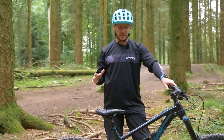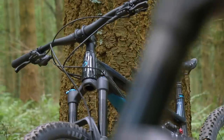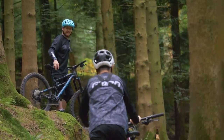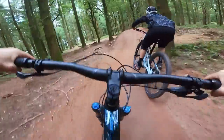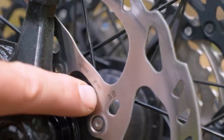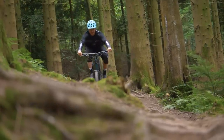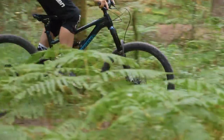The N9 is a mid-range bike and there's not much you'd really want to change on it — it's a super capable bike with 170mm travel front and rear, and even on the 29-inch version that's 160mm, so it's a big bike for big mountain trails. The main upgrade would be the disc rotors — they're 180mm front and rear. I'd probably go up to 203mm on the front, maybe keep the rear at 180mm or go a bit bigger, just to help dissipate heat on a big-travel bike.